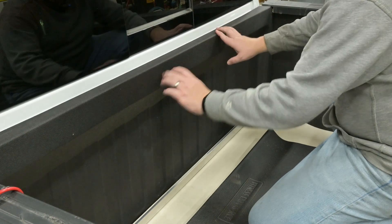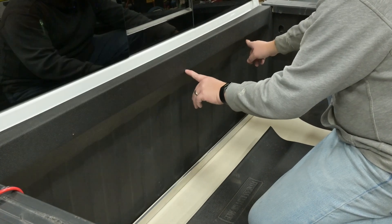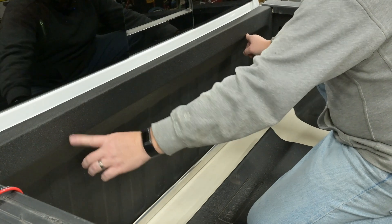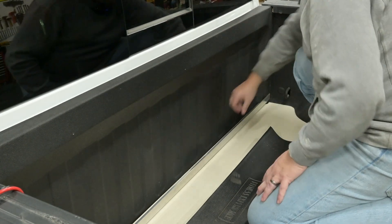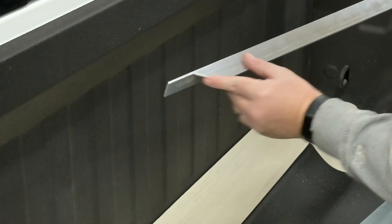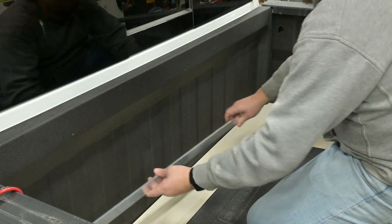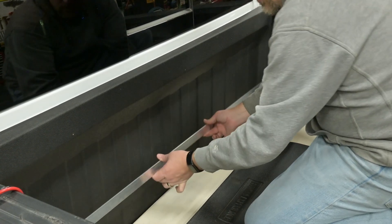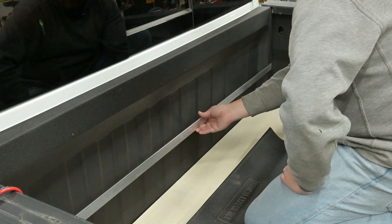The way I think this is going to work — you might actually be able to see there are three real small holes here. These were for some snaps or rivets for the snaps on a soft cap in a former life with the truck. I'm going to go ahead and open these up for a larger bolt, something around a 5/16, to hold the plywood up here. I've got this piece of aluminum angle iron that I've basically just cut so that it meets this angled shape real well, and this will hold the bottom portion of the plywood and give us all this space for insulation back here.